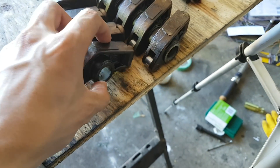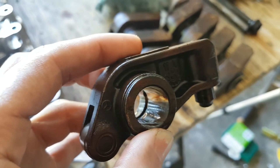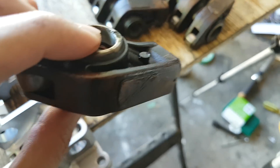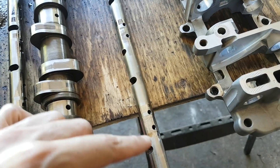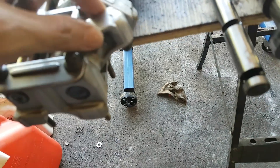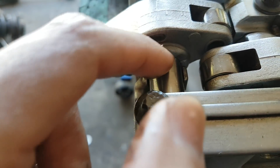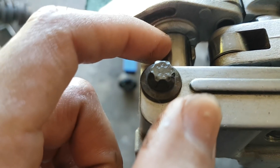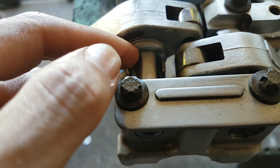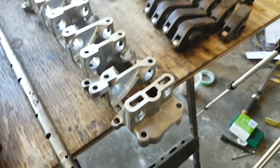These holes in the shaft line up with holes in the rockers — there's a tiny hole in each rocker, and a groove so that when the rocker changes position it still gets oiled. There's also a small passage going from here to the hydraulic lifters — oil pressure flows through the rod and through tiny oil passages to your lifters. One thing to check for is that your rockers shouldn't have too much play on this rod. If there's too much of a gap, oil pressure wouldn't go to the lifters — it would all leak out through the gap. Also make sure all oil galleries are clean, because if any dirt gets in the lifters they will start ticking.